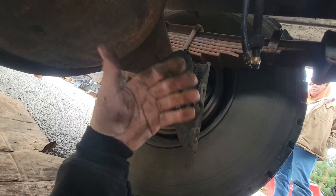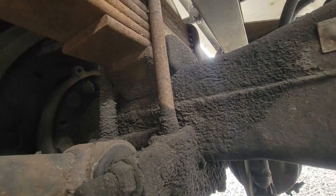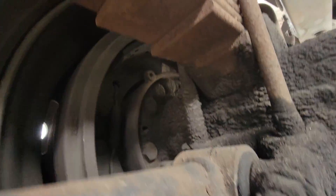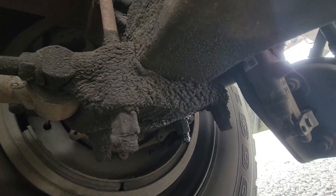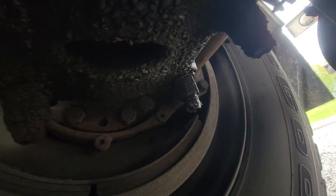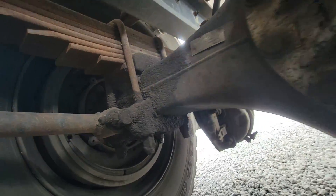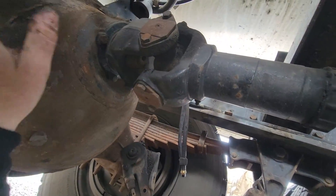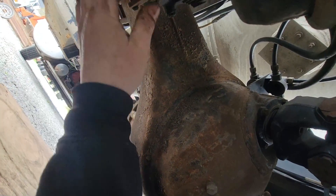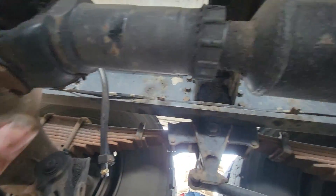When I'm down here doing a repair, I always look at everything — give it a look over and see if there's anything of concern. Like an axle that's cracked. That is a bad axle housing. The axle housing itself is probably cracked, like the Peterbilt was. I like to lay my hands on anything I can and inspect — look, touch, and feel — just to be safe. This is how you catch things so you don't have breakdowns. You're constantly looking and inspecting.